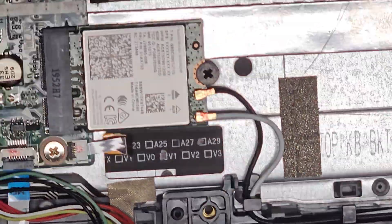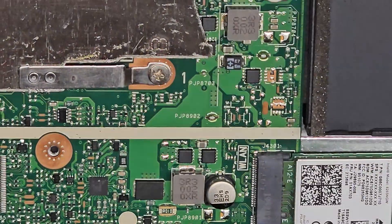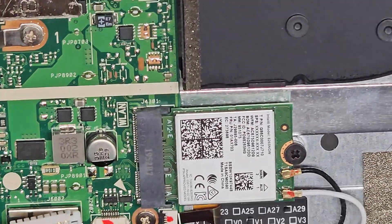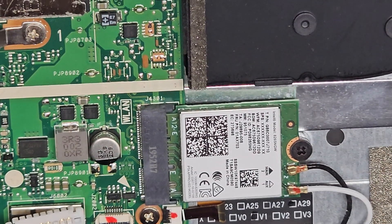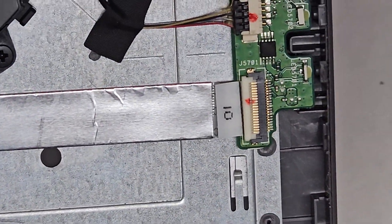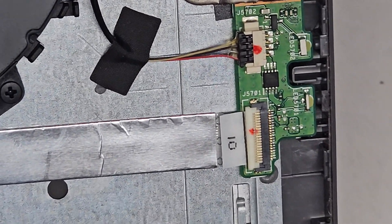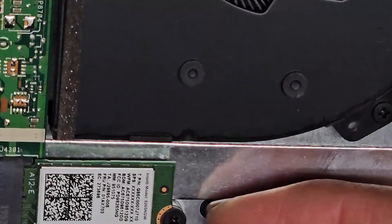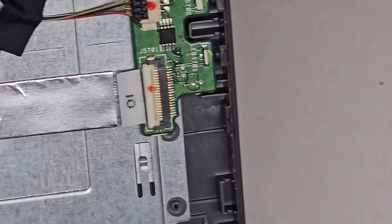The wireless card is there — the antennas go from the tail if you want to pull it out straight up. If you want to see a video on how to do that, watch a few of my other videos. The reason I don't always show it is sometimes the solder on the connector is not good and the little connector rips off. It's pretty rare, but I don't do it unless I need to because sometimes it can lead to damaging things if the part wasn't made properly.